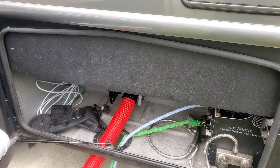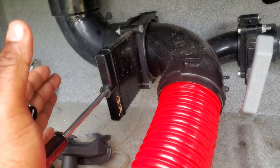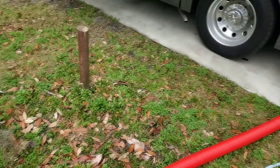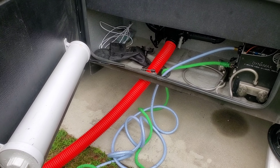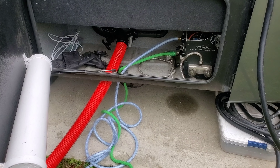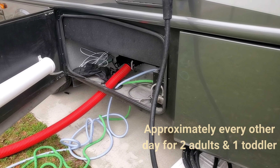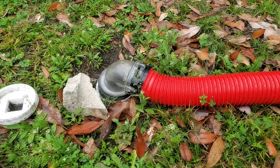Our RV has a 45-gallon tank for black water and a 45-gallon tank for gray. We've successfully dumped our black. I also have a fresh water line that connects to our black tank, which gives me the ability to completely clean it out. So we'll fill it up with water right here at the hose to our black tank so I can clean and sanitize it. What we'll do with our black is pump 45 gallons of fresh water in there, churn everything around — any solid matter that's in there will get removed and flushed out. I like to do it every one to two times that I flush my black just to keep everything clean. And here's where our hose connects into the sewer line and everything just flows right down into there.